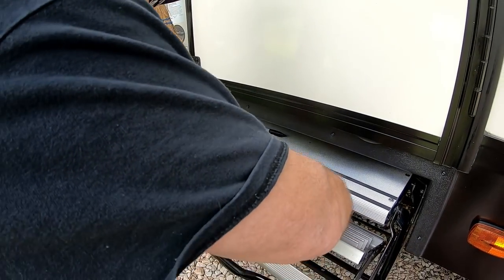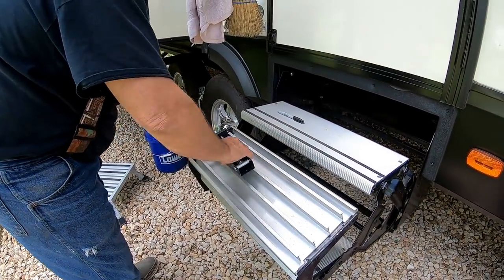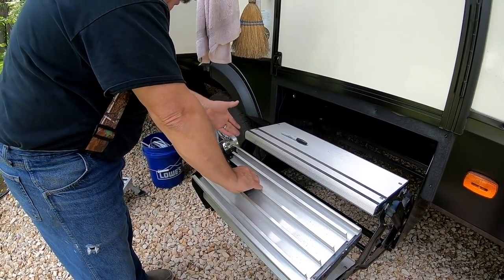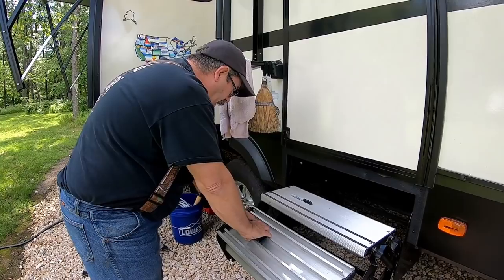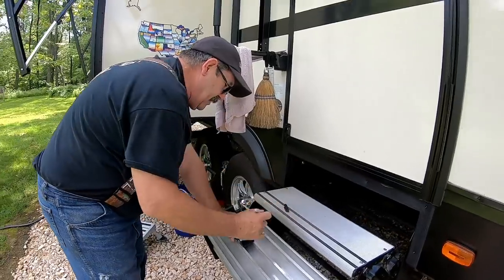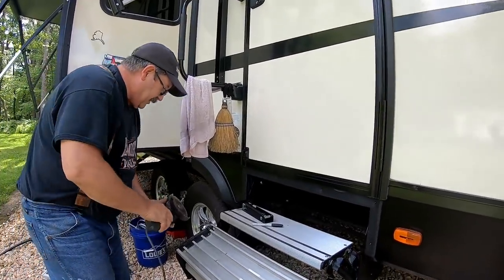Hard to do this if I get my fingers smashed. I think I might have a little bit different idea. I really would like to have it in the middle, but the easiest way is to go over here and knock the lip off of that ridge, only where I want to mount this. Since most of your weight when you walk into a camper is on the left hand side, I'm thinking just to knock that off. If I can get the rib off and get this mounted all the way to the bottom, all my problems would be solved. So with that approximately in the center, I'm going to mark this and pull out the magic grinder.